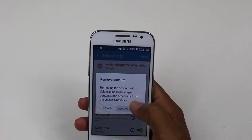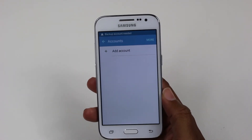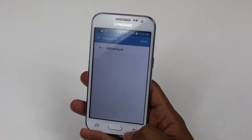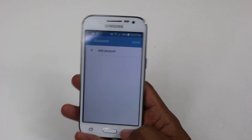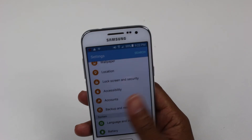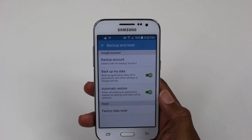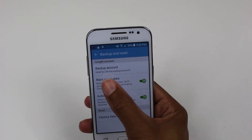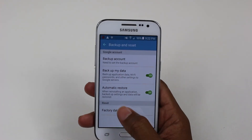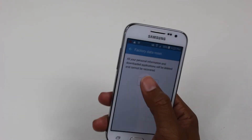See, this account is on there right now. I'm going to tap it and remove this account. If you don't do this first and you try to reset the phone without the password to that Gmail, you're screwed — it will not let you sign back into the phone. The phone is basically a brick. Now that we've removed the account, go back up to Reset, and see — there's no backup account now. Go to Factory Data Reset, then Reset Device, Delete All, and you're done.